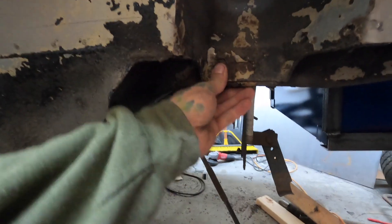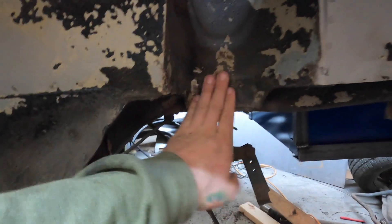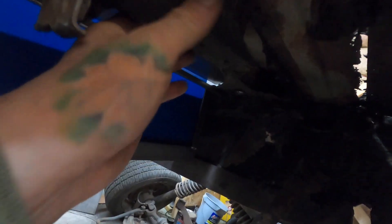If you see this, it's not even that bad. What I'm going to do is just clean this off and make sure that it's good to go. But underneath here, as you can see, this is like a frame rail box section. I'm going to try and cut this out with the bad metal that's under here and probably weld in a piece of angle iron just to give it a little bit more structure there. And then for the most part, that's all done for the rust repair.